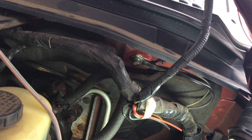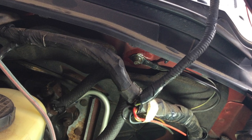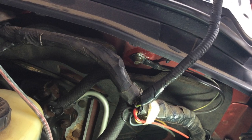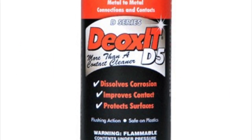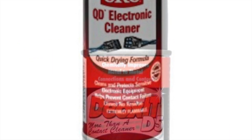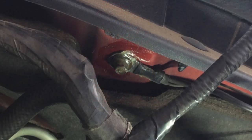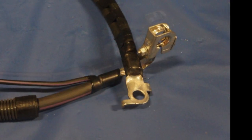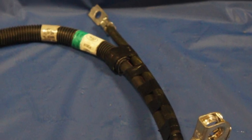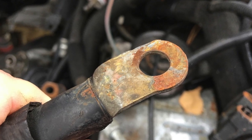Everyone needs to choose their own path. A less aggressive way of dealing with the body tub terminals would be to disassemble the connection, spray clean with DeoxIT or electrical contact cleaner, abrade the terminal and bolt with wire brush or Scotch-Brite, and reassemble with grease. With the battery high-current negative connections to the frame, there are none of those tooth-washer features, most likely because they need a large contact area on both sides for the high-current load. These should be cleaned and protected maybe every 5 to 10 years, depending on your environment.